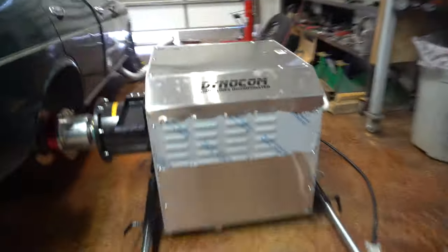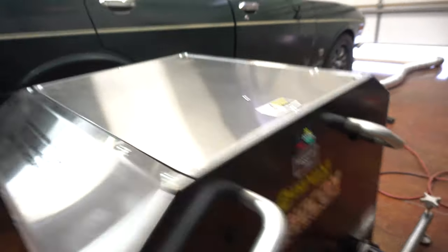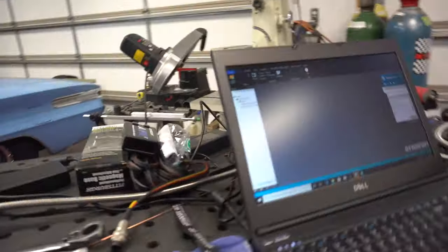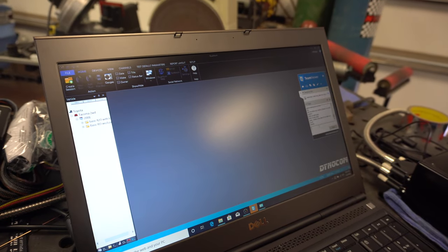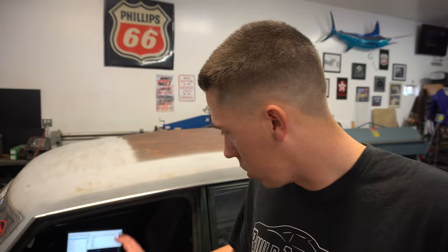And 246 volt there. So that's a pretty cool little display on the back there that gives you all the information you should have. We verified that it has the voltage that it's supposed to at each pod. It says what's the diameter of the tire that the car runs, so we put in, hey, let him know, 23. So he'll probably come up here, create a new session, and go through all the things like what we did. We're gonna do our first pull here with the hubs actually active and get a horsepower reading and all that. Hopefully it all goes smooth. I gotta try to lock this car into fourth gear, otherwise that's a whole nother issue I gotta try to figure out, but we're gonna do our best here.